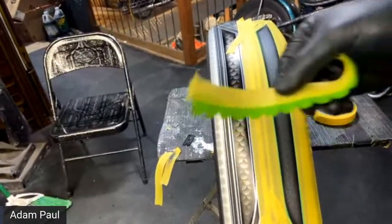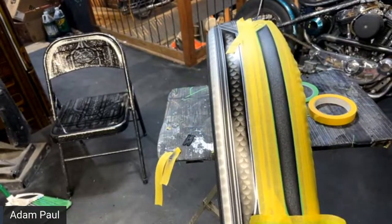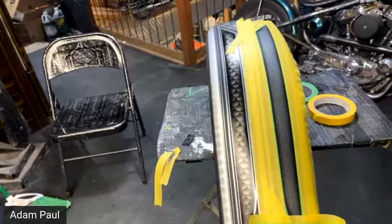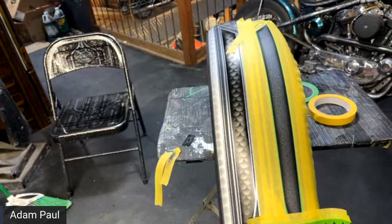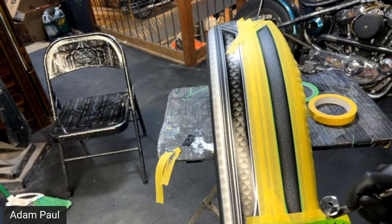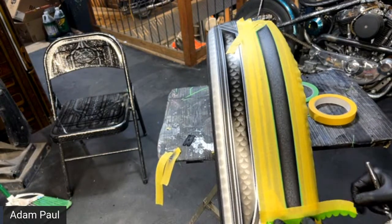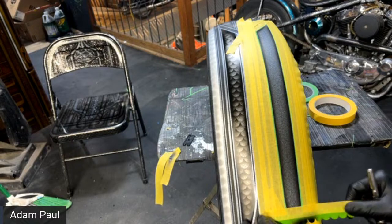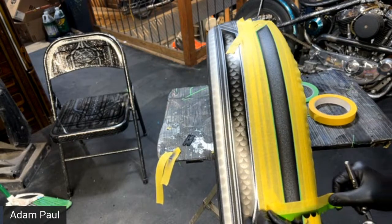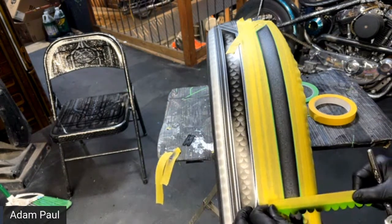All right, once again, you missed the earlier side right here. You just start at the bottom. Make sure you're lined up square with the fender. That's better. Aim for the stencil and just let the blend kind of go down. Let it blend down. Don't aim for the part itself. Aim for the very edge. I'm going to try to blast through these real quick.